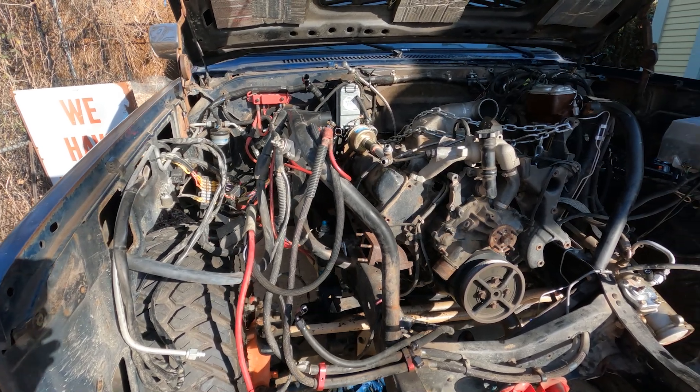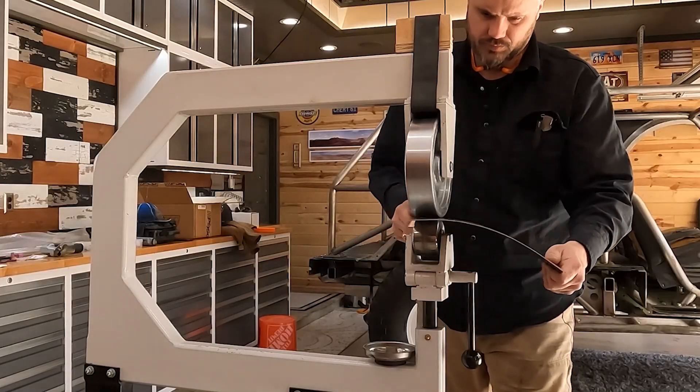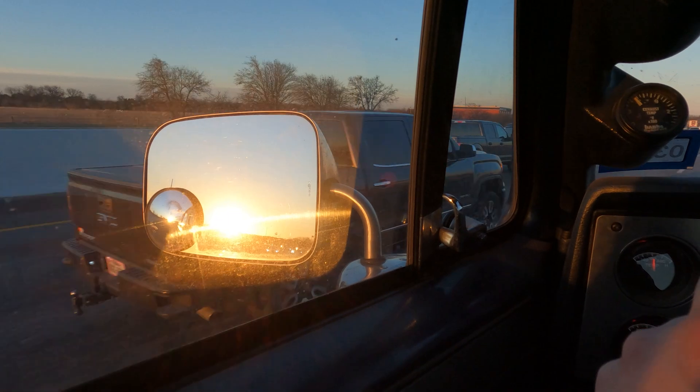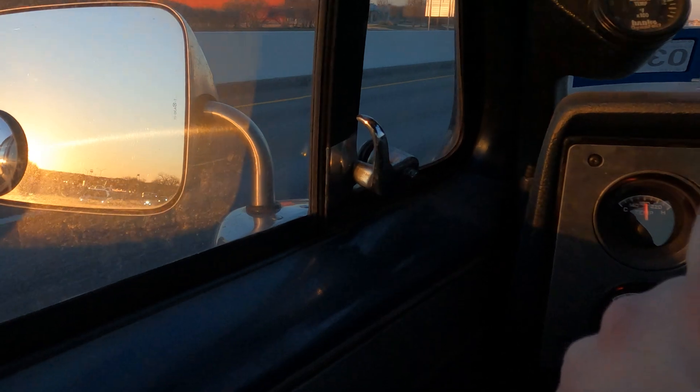So I was on my way back from Greg's about three weeks ago. I had shot the video with the English wheel and we were doing some TIG welding — great time, end of a great day. He and I had run around in the truck just a little bit, and I noticed my oil pressure was kind of in a different spot than normal. But when we got back and I was idling, it was fine — normal spots. And then when I left, it recovered and went back up to normal. There I am on the highway, north on 35, and I looked down. You can actually see in one of the little videos when I was shooting leaving, down in the corner, you can see that the oil pressure is way off. It's supposed to be about 40 pounds driving down the highway, and I was at 20.